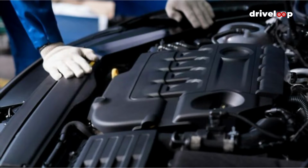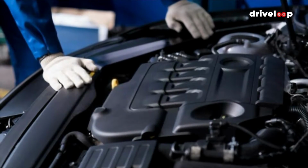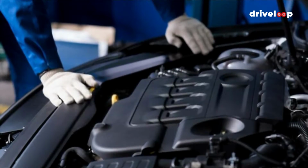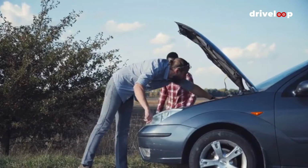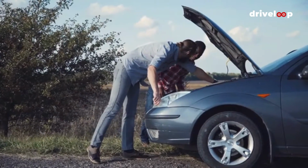Using plastic bags, cover any sensitive electrical components, such as the battery, ignition wires, and engine control unit. If there's an exposed engine air intake under the hood, you'll want to cover that as well. If you feel like you'll be particularly careful with your rinsing, then you can skip this step. However, protecting these electronics will allow you to clean more thoroughly with less risk of damaging anything.